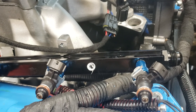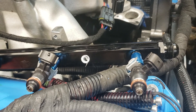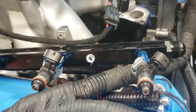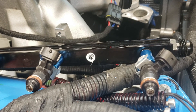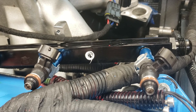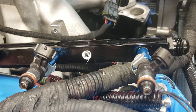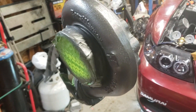There's a port on the bottom side of the Sullivan rail — I think for a fuel pressure sensor. They're on both rails. If you're not going to use a pressure sensor in those spots, take them out, put some Teflon on them, and thread them back in. Just something I wanted to point out.